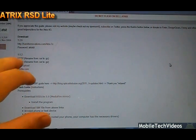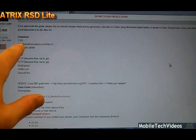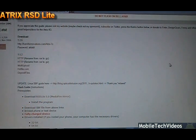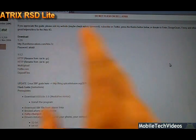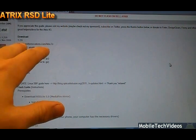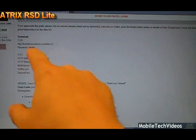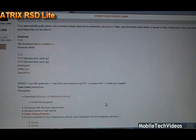Keep in mind, if you'd like to go to the newest update and get the benefits of it but maintain root, you need to flash the older one first. Then we'll do a process that will install root, and then we can do our upgrade and maintain root. For this tutorial, we're simply going to show you how to flash back to 1.2.6. When you download it, it comes as a package — use 7-zip to unzip it. The password is atrixbl, all lowercase, no spaces, no special characters.